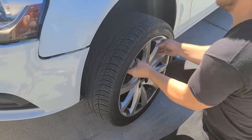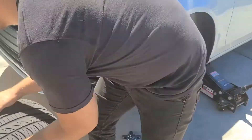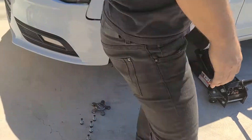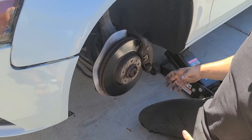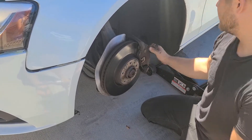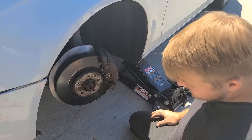Wheel's off — we're going to roll it away. On these European cars we're actually going to do a full change of the brakes and rotors. You want to change both the rotors when you change the brakes, because it's such a pain otherwise and you don't want to deal with it in the future. Looks like we have a clip in the front and a couple bolts in the back — let me grab the right tools.